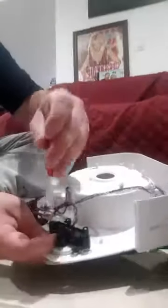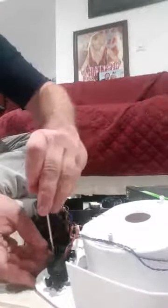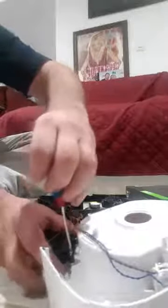To get to the switches, they're right here. There are four screws holding this in and they're silver, which makes them a little different and easier to spot from the others. The ones on the bottom are small and short. Be really careful with this assembly because this thing does come apart and every one of the four buttons will go flying — there are little springs attached to them.